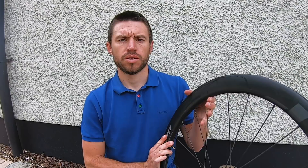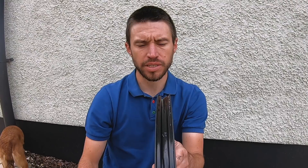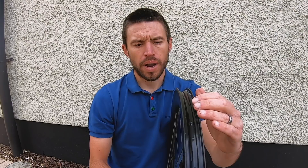I've just taken the tire off to give you a better view of the rim and explain what's so different about it. It is hookless — on a standard rim you've got what's called a crochet or hook, which came from 1940s or 50s design to keep the tire on the rim. There's a lot more tighter tolerances on tires now, and especially with this setup. This is tubeless and is only designed to be used with a tubeless tire, because of the rim bead type and making sure it stays secure.